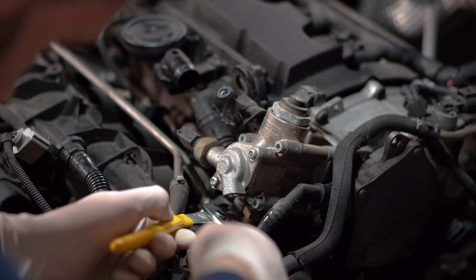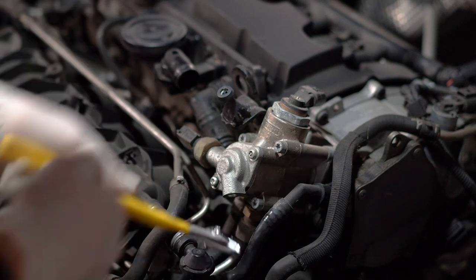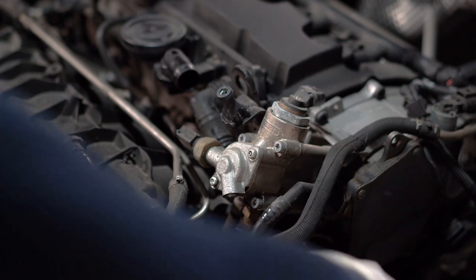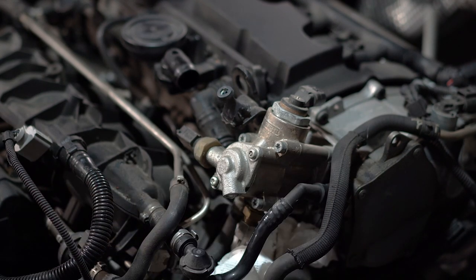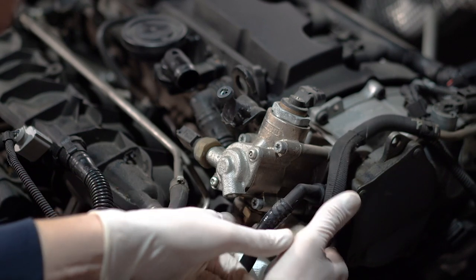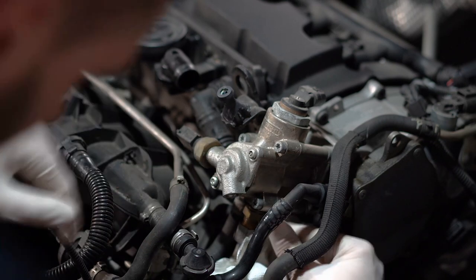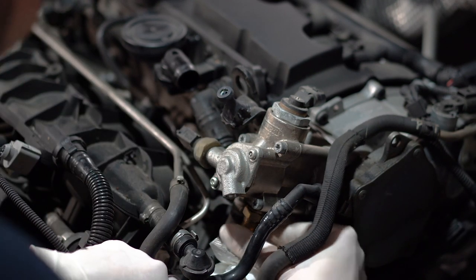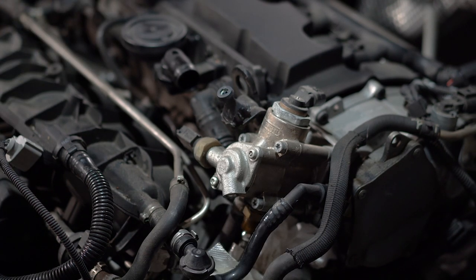This screw — I think it's 17mm — I used regular pliers to unscrew this big screw on the bottom of the fuel hose. Some more gas sprayed out on me, so I panicked again, took a paper towel and continued unscrewing. After that there wasn't any more fuel coming out, but it's always a good idea to have a paper towel when working on stuff like this to keep the rest of the engine clean. I'm holding my hand over it so if it sprays again I don't get it in my face. Now that we've disconnected this pipe, there is one more hose on the left side right next to it, but you don't have to disconnect it — I successfully replaced the cam follower without disconnecting that hose.